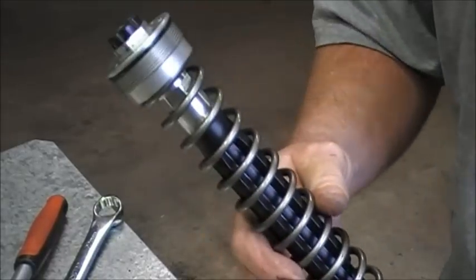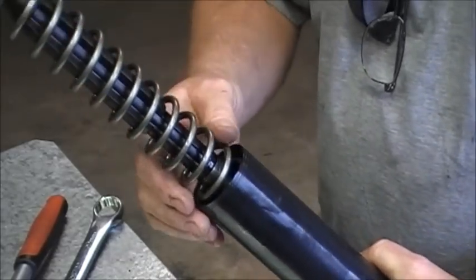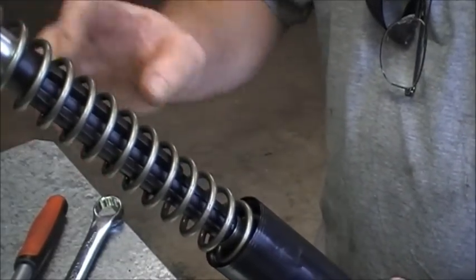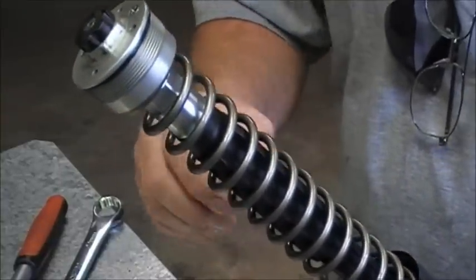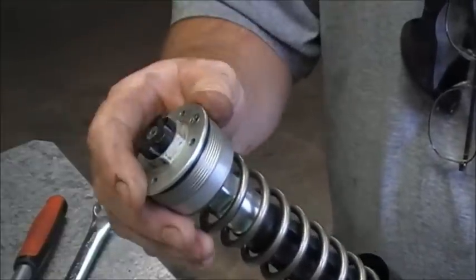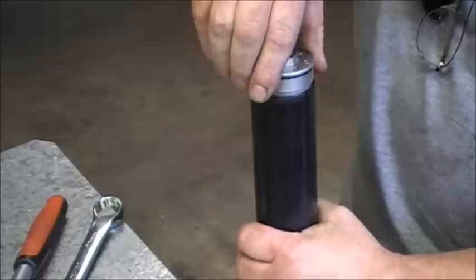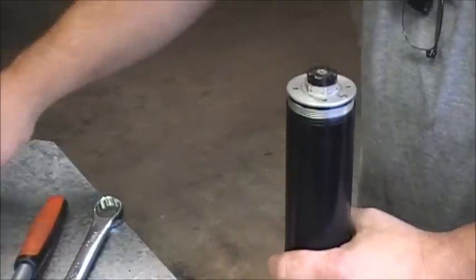And there you have the hydraulic stop with the extended piece. What's going to happen now is that there's no changes with your fork at all, other than the fact that it's just going to bottom out in the hydraulic stop 22mm before it would do with the standard one on there. And then that's going to take into account the mod that you've done with the triple clamp. That's it — we'll just put the bike together. Thanks for watching.